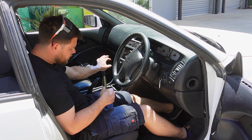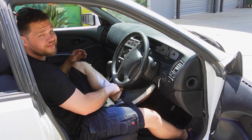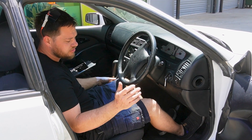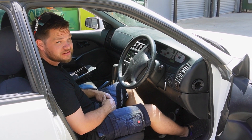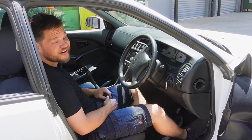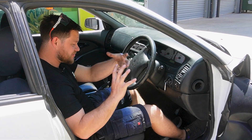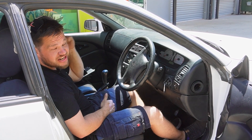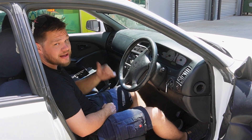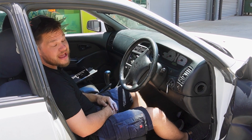So, push the clutch in, put the car in gear. The handbrake's still up a little bit, but I don't think it's going to stall. I'm not pushing the clutch. Handbrake down — almost no movement from the car. Still in gear, still not pushing the clutch in. We'll go to second. There's something internally in this gearbox that's wrong — it's still trying to transfer power, which doesn't transfer it to the back. That's issue number one. We'll get the car in the shop and progress into issue number two as to why we did this wrong and how we can improve in the future.